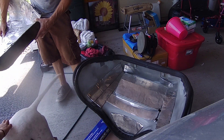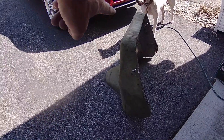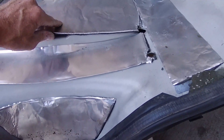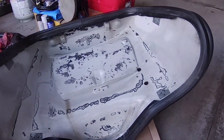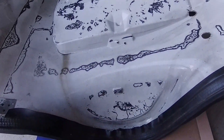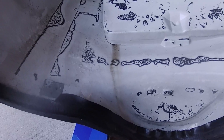Oh, look — that's clean. It already has some stuff. So interesting — you see what I saw when it pulled out. So that insulation piece came out, and then underneath it there's already some strips of sound deadening material in here. I'm guessing — I don't know if this is factory or if the ambulance builders did this — this is some really thick stuff. I was able to get all of those pieces that were stuck down in here; they weren't stuck down very well. You can see where they just kind of spooed some glue arbitrarily here and there, so it all peeled off pretty easily. Now I'm just taking some Spray Nine cleaner and I'm going to wipe this out — it's just got some road dirt and all that.